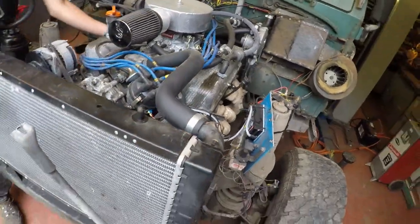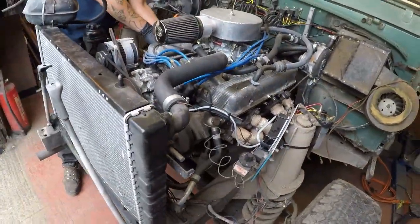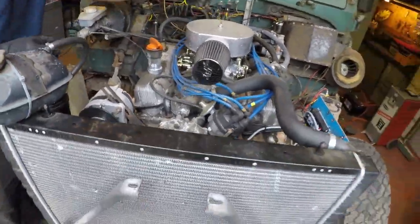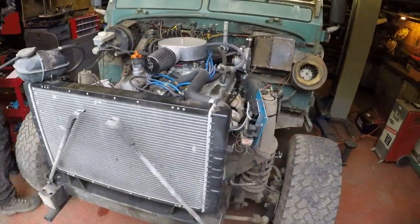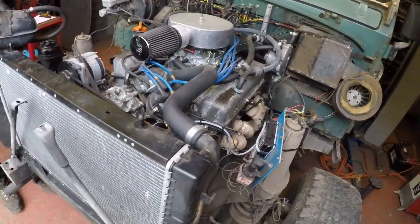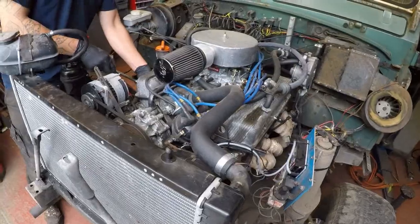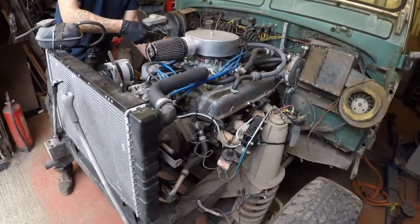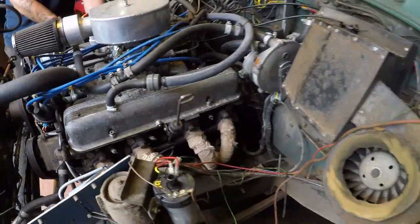Good tip: give it a little run first. We only remove one spark plug at a time to do a compression test. The reason we do this is if you have a failure between two cylinders, the compression will just come out the spark plug holes and you won't notice the transfer of gas. So if you do one spark plug at a time, you'll get a much truer reading. It does, however, use a lot of battery.